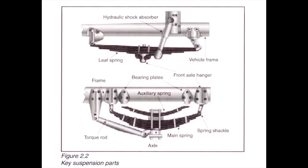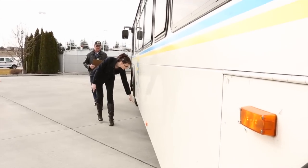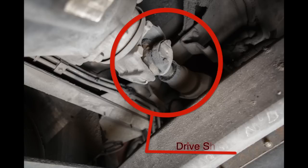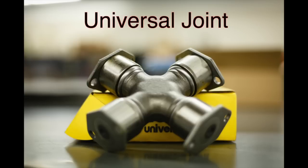Be sure that the torque arm is securely mounted and is not damaged. Check the frame to be sure it has no cracks or bends, and there are no loose or missing bolts or cracks in the cross members. Check the drive shaft to be sure it is not cracked or bent, is securely mounted, has no missing nuts or bolts, and there is no debris in the U-joints.